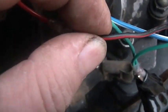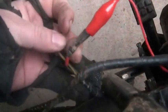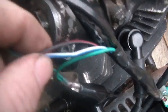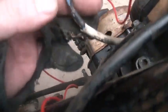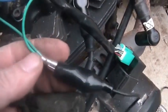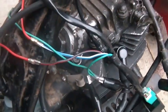See the red and black wire? I put a red alligator clip on it to extend it and hooked it to the red and black wire here — that's it. See this blue and white wire? I extended it with an alligator clip and got it going to the blue and white wire right here. Then the green wire — I extended it with a green wire, put it right on the green, and I should have put another green wire on it just to hook to body ground. That's the only things you've got to do.